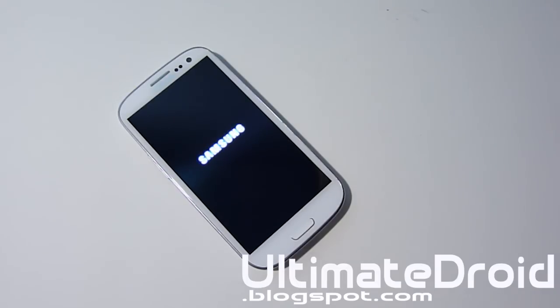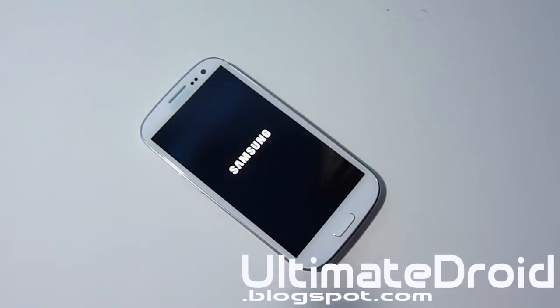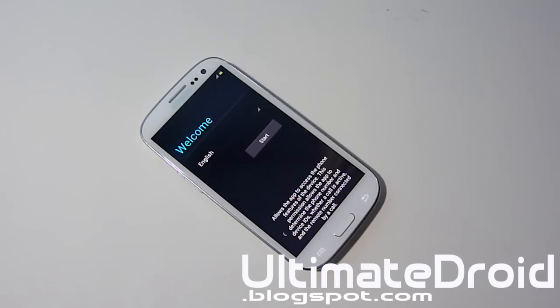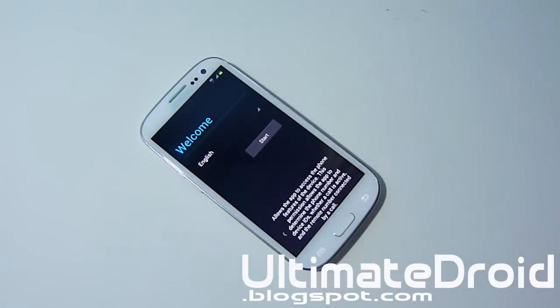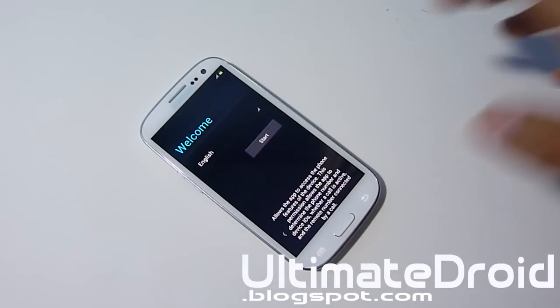When your phone finishes booting up, do not touch it for 15 minutes — yes, 15 minutes. Do not touch it or you're going to run into problems. About five minutes after the boot animation you'll be on the home screen — do not touch your phone at all, not even the start screen. Let it boot up for 15 minutes total including the boot animation. If you don't do that, you'll run into force closes and errors saying things have stopped working. You have to let it load the custom ROM and all the apps for 15 minutes, then you can start pressing the home button.